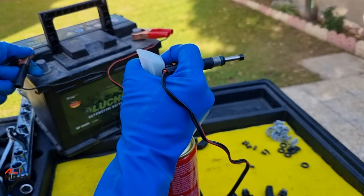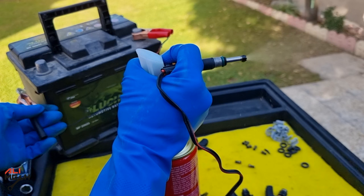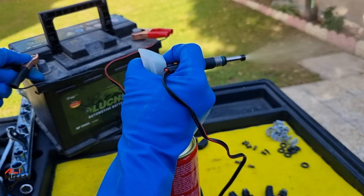I recently cleaned fuel injectors on a different car — we could see it leaking fuel, with carbon trapped inside and not letting the solenoid close properly. But after a few sprays, it got better and stopped leaking fuel.